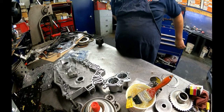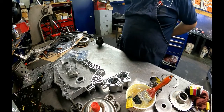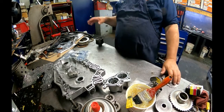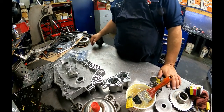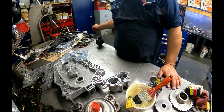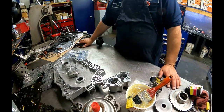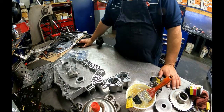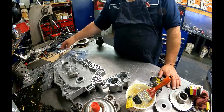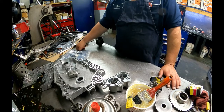All right, let's see if we can get a little bit of this done before we have to turn that fan on. Doing this 4T65E HD. Doing an LS kit, which is a kit with clutches. Adding in the second gear steel like I do on all of them. The third gear steel. 1, 2, 2, 3 accumulators. The bushing and the input drum. Pistons, filter, KO98 kit,